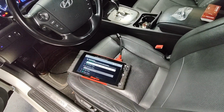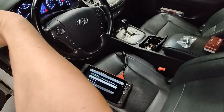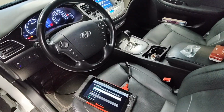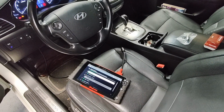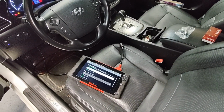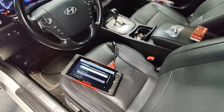So yeah, but other complaints I had, like, I think it was another Hyundai Accent where this customer would just be cruising along the road on the highway or something, and then the RPM would just drop to 0, but the engine's still running because you still accelerate and all that kind of stuff. Because when you're cruising at that speed, your car still uses cam sensors for other inputs to keep your engine running. But it always happens when you come to a stop, the car stalls.